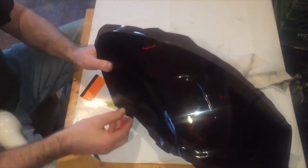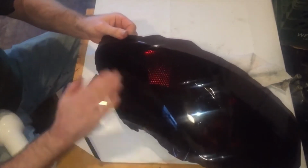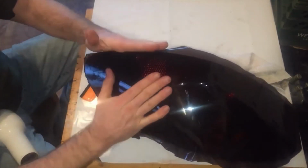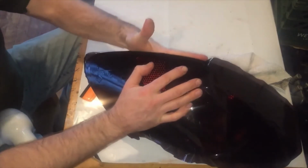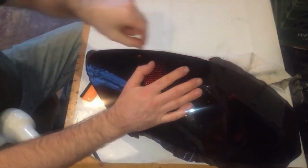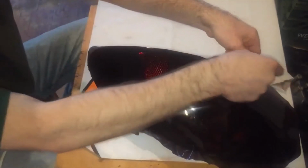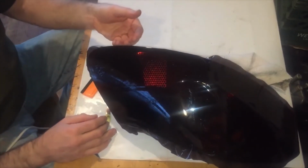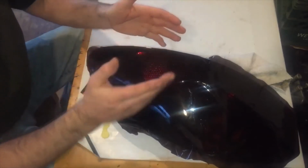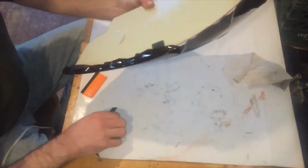Tuck it. Start tucking it so we can get the shape. Now that this whole section's done, we're gonna start tucking it. I know it's a lot because we're gonna trim off the back side. And tuck it, then we can see. I don't like when people just cut it right here. When they cut it to the edge of the light, they just hold the trim and cut it to the edge of the light. Because sometimes you can still see the light when you see it in the crack, and that's unprofessional. So you have to tuck it, and then you have to come back here.